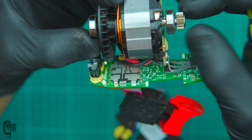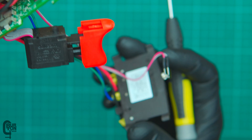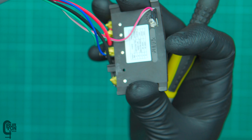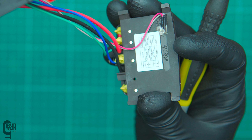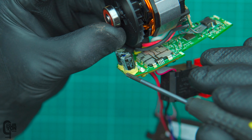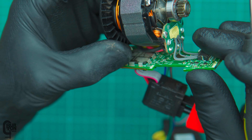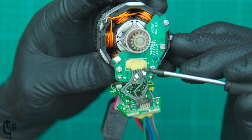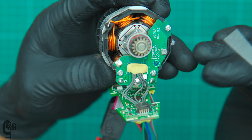Keep in mind, we do have a fan here and this fan spinning is blowing air directly onto all of these heated components, so maybe it does work. Of course, these guys are engineers that design these things, so I'm sure they've taken that into account. But a lot of times what you'll see is the speed control actually mounted to the bottom of the battery sled where there's quite a big aluminum heat sink that's able to radiate heat away from the working components. I do like that all of these capacitors are also glued into position — and same thing over here: these hall sensor wires are also glued into position. This is going to help the wires not break due to vibration.